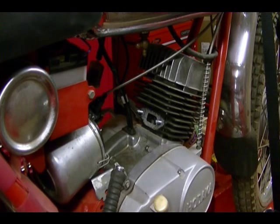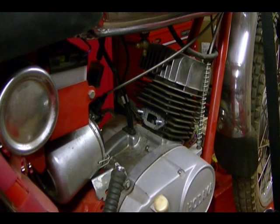Now I'm going to prove that the piston doesn't interfere with the leak down test. I'm going to leave the piston at bottom dead center, remove the spark plug, reattach the intake manifold, and set up my pressure pump and gauge on the intake. If the piston does create a seal, I'll get a pressure reading on my gauge; if it doesn't, the pressure will go right past the piston and out through the spark plug hole.